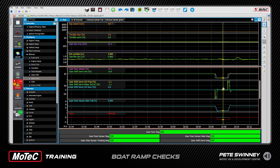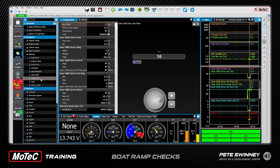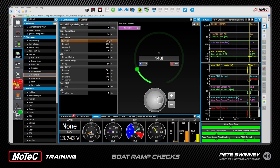Pressing F6 and over here on the left you'll see some parameters. Under Gear Shift, here are our aim points. Under Position, this is the aim for reverse — we were only reaching 15. I'd do this a few more times, and if it eventually reaches 14 we could leave it there, but if it's only ever going to reach 15 then we'd update that aim. Neutral was fine and it was reaching the forward aim of 93. As long as that's all working clicking in and out of gear, we're good on that side.